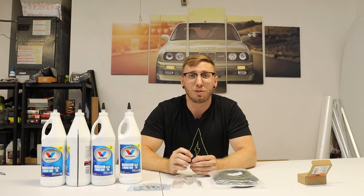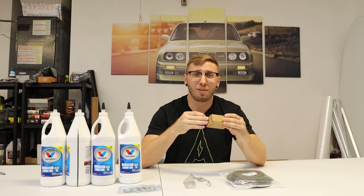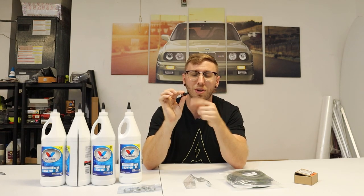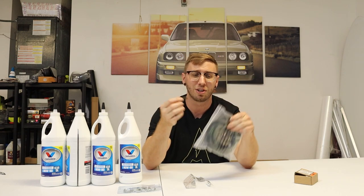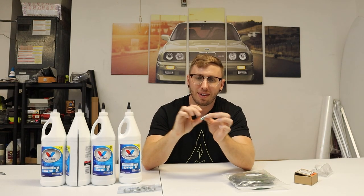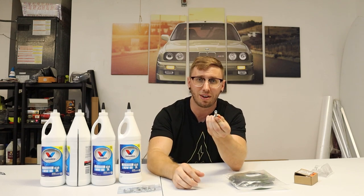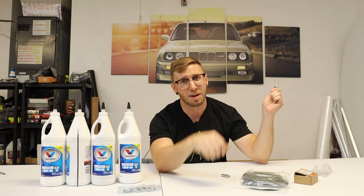It's a very easy thing to address and a very easy install you can do at home. The first thing you need is a diff breather - I'll put all the parts in the description below. Everything I bought was from Amazon, so I got shipping within two days. This diff breather is not threaded - it has a fitting for a hose to fit on it. That hose is the second piece of material you need for this modification, and it will help relocate the diff breather up to a higher area of the vehicle. The last thing you need is a threaded union that fits the same thread pitch as the factory diff breather. We'll unscrew the OEM breather, thread this in, fit the hose over it, clamp it, and mount the new breather up high.